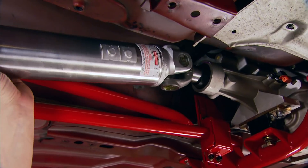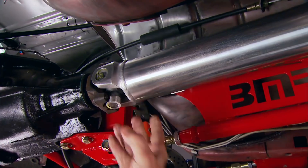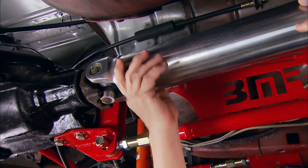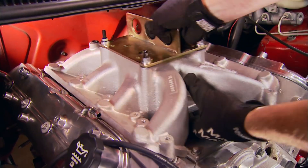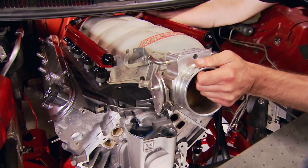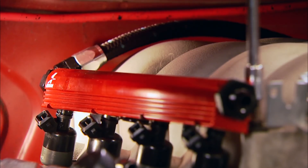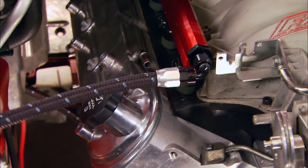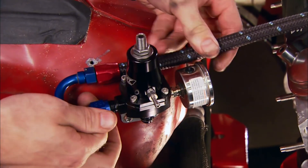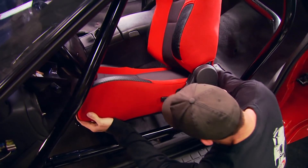From the pump we'll run a hose to the original hard line. While he does that, I can install our new driveshaft from Dyna Tech — it's got a 31-spline yoke, made with high-performance racing aluminum, and the 1350 U-joint is the biggest and stoutest they make for passenger cars. With the car back down, it's time to bolt down the FAST composite intake, upgrade the fuel rails with a pair from Aeromotive to make a loop with the fuel system, and install this fuel pressure regulator.